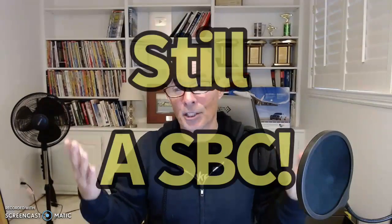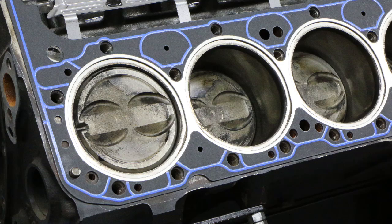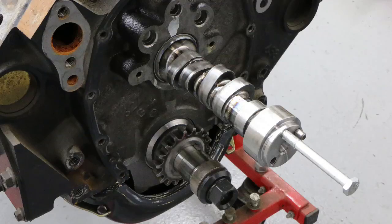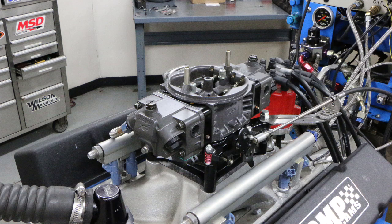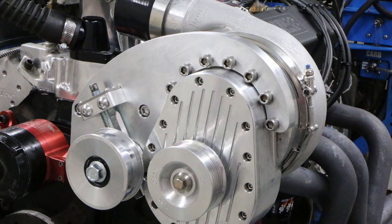The takeaway: it's still a small block Chevy, so yes, it responds to all the normal modifications — cylinder heads, camshaft, intake manifolds. With the smaller bore, there are fewer head choices than the 350, but you have options: the 305 Vortec head, the Trick Flow head, or porting the existing head. Lots of different camshafts and induction systems are available, and if all else fails there's always nitrous or boost. Make sure to like, share, subscribe, and ring the bell — I'll keep testing!